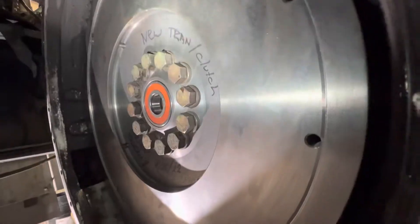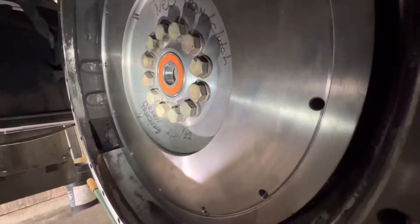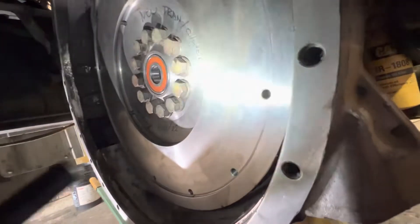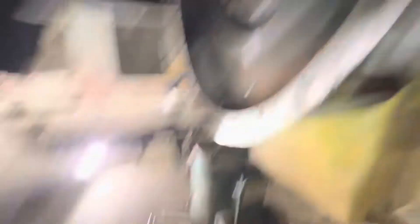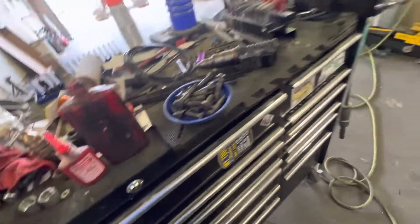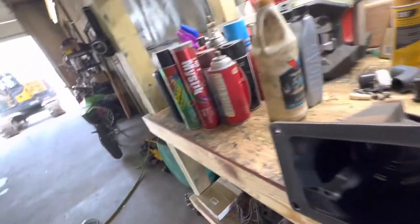Right there — just cleaned out. I usually write my name on it, new transmission, new clutch, the date — whatever. These bolts I don't torque; I just buzz them in with a half-inch impact. Those bolts get wire brushed with a high-speed wire brush so the thread is completely clean, then I brake-clean the threads in the crank, and then I use Loctite.